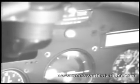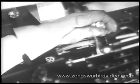You can carry this power up to 13,500 feet, where again you will note a loss of about three inches of mercury. If you want more altitude, throttle back to lose an additional three or four inches, shift to high blower, followed by 48 inches of manifold pressure. Always keep your intercooler flaps about half open when using low or high blower to maintain intake mixture temperatures within safe limits. A red warning light will indicate excessive temperatures and warn you to reduce power — open the intercooler flaps wide, and if necessary, shift to a lower blower. Use automatic rich for all your climbing and maneuvering; if your mixture is not rich enough, there's danger of burning up the engine.